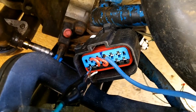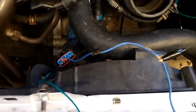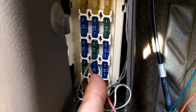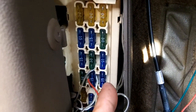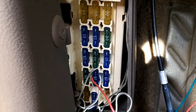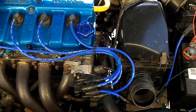I've already shown you both pins on the Transaxle Range Switch connector plug side and on the relay side. I did switch one of the wiring though. This is the power wire for pin 30 on the relay. I went into the radio fuse, which is the second one up, and that worked. As you saw before, it was shutting my radio off on that one, so yeah, don't do that. So that's the ticket. It works. So that's all there is to it. I am now road legal. I can drive this at night now, forwards and backwards.